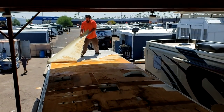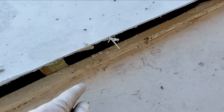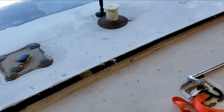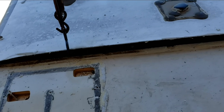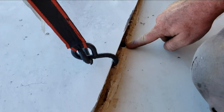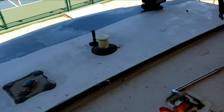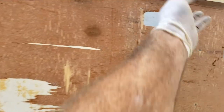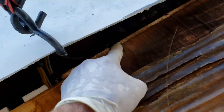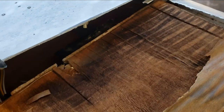Chad might be upset with me because he's in the sun, not me. On the front here it's pretty surprising — there's maybe an inch overlap between the cap and the roof. Unsurprisingly, it had been leaking there, because for some reason they decided they don't have to put lap sealant on their front caps. They also did not even cover their alignment hole on this side — it's an eighth inch, exposed and uncovered. I started ripping this up and I think it might have been leaking through that tiny little hole Winnebago put in there. Thanks, Winnebago. That's a brilliant idea.